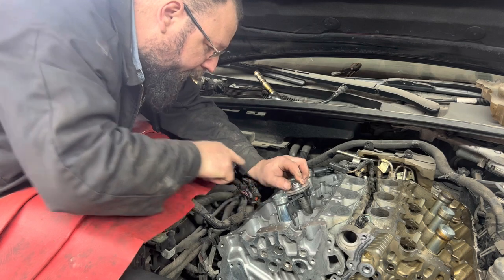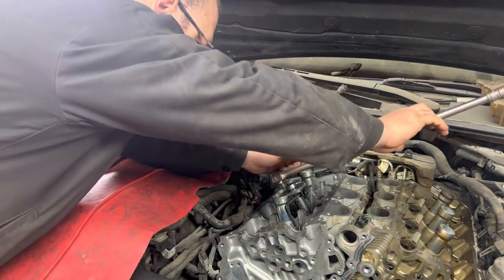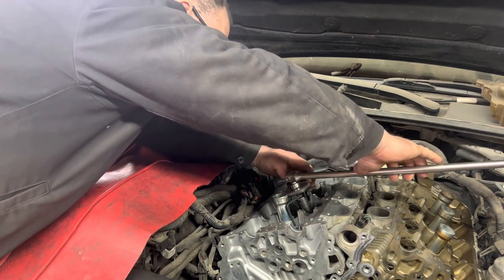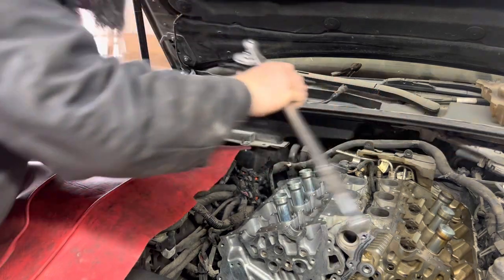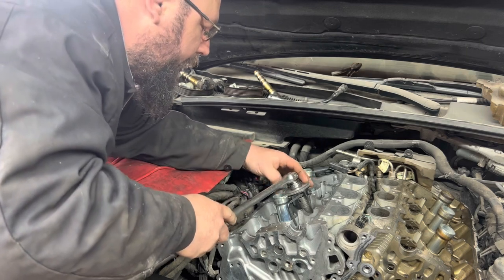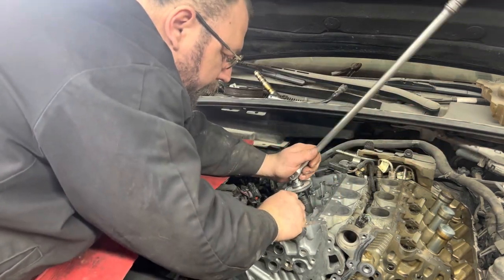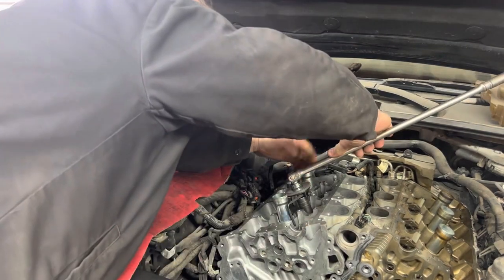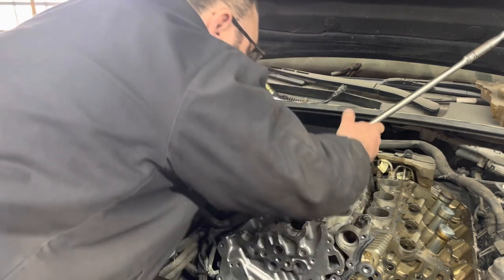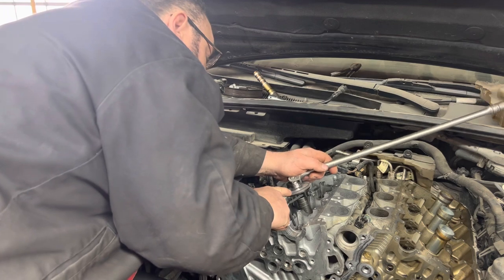That way you get a nice even torque. This is going to be 150 degrees, so I'll put it on zero. 150 degrees is one mark lower than 160. It's preferable to go in one motion, but this is a long way — I don't know that I can do that. This is where the Snap-on torque wrench really comes in handy, because you can ratchet it and it will keep track of your angle — that's why I bought that other one. Now we have it set up. Rotate our mark up to zero, and we'll torque it until it gets to 150.